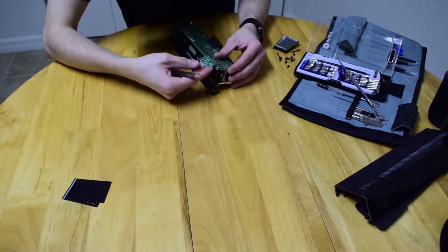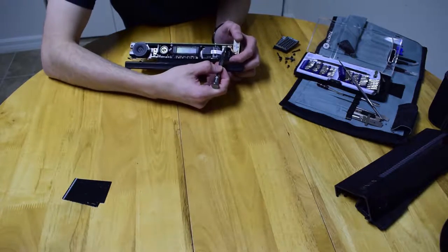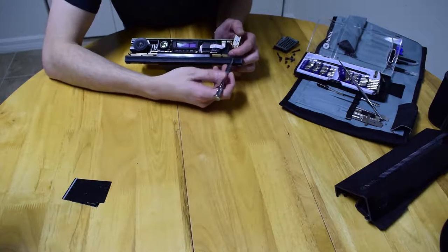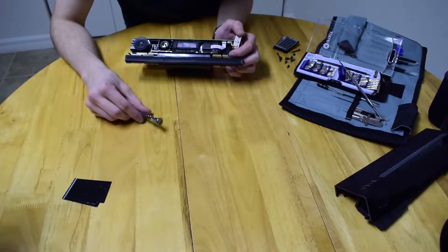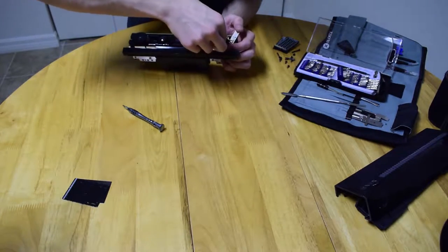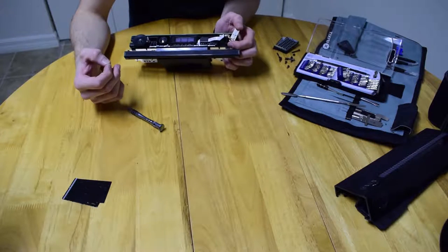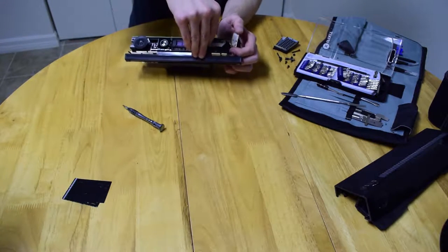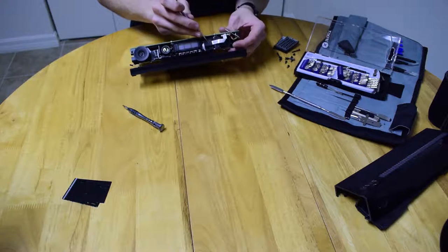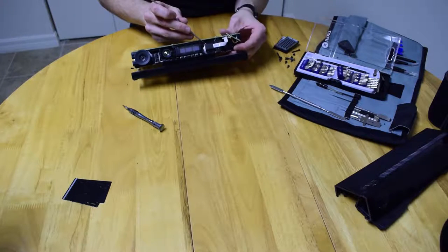I freed the little light just to get it out of the way, and now I can access the ribbon cable here, which threads behind the hinge right below the IR array, down to the microphones. The ribbon cable connector is not the liftable type — it doesn't have the little locking tab. This piece here kind of looks like metal but feels like ceramic — it's called a ferrite core, which is basically just noise filtering.